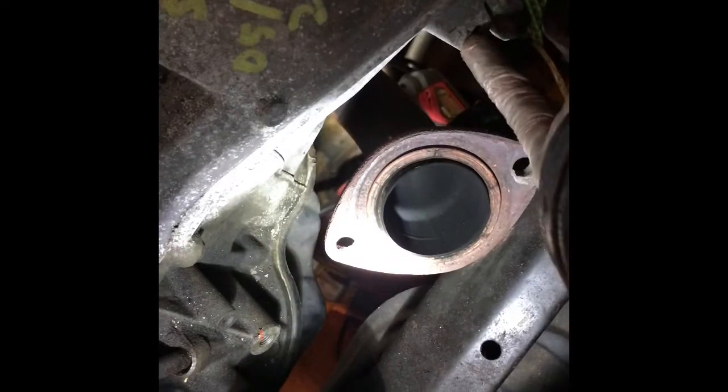Another 14mm is right here — see this bolt, right there. Two 14mm on both sides, let's loosen it up. Take from here — this is one bolt right here, another bolt is right there. Take from the engine block, take from the manifold.